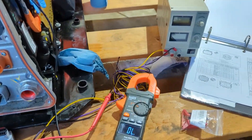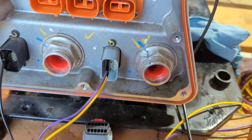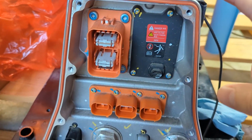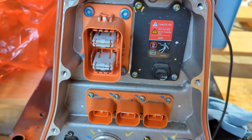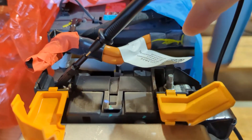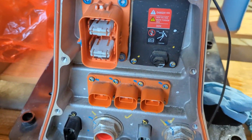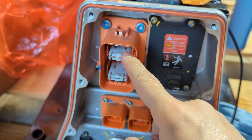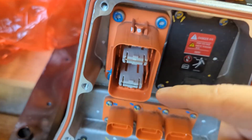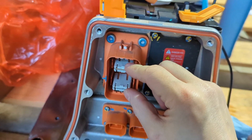Quick video about what I've discovered so far. I'm messing with the Chevy Volt battery pack — I think it's the x358 or x357 connector. What I basically want to do is convince myself that I know how to control the contactors. The Chevy Volt has three contactors: one closes the positive lead and one closes the negative lead connecting to the battery, which then goes directly to the inverter or motor.